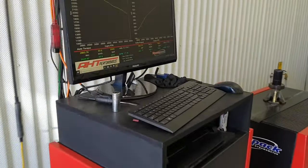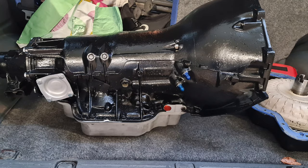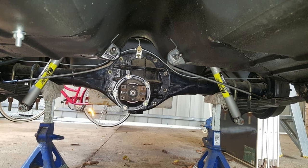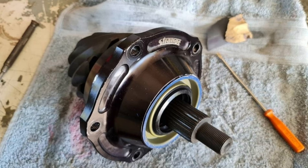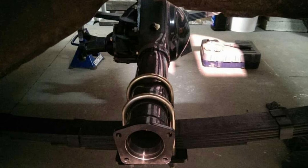The 400 horsepower is put down through a fully-built reverse-pattern Turbo 400 built by Mark at Sunshine Coast Chop Shop. It has a custom 3.5-inch tailshaft with Strange yokes built by Farrow Shafting. Up the back is a shortened 9-inch diff out of a Ford Bronco that has Ultra-9 chromoly axles, chromoly stub axles, 3.73 gears, and a Topcog LSD. The diff was put together with new bearings, new gears, and a new sender only six months ago by Topcog. Both the transmission and diff were built at the same time and only have about 200 to 300 Ks on them.